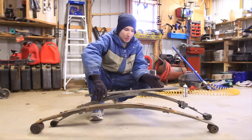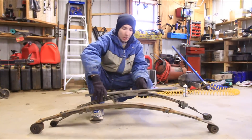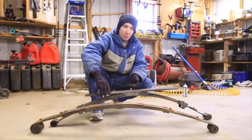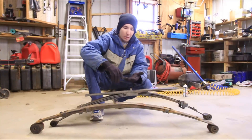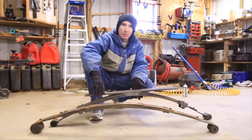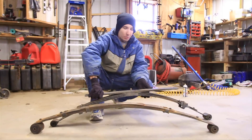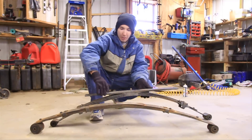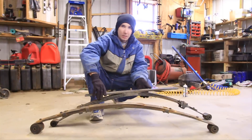There are two different ways you can do this — well, there are a lot of ways — but I'll show you how to get a two-inch lift all the way up to a three-inch lift on the springs. You can also combine that with blocks or longer shackles to make any kind of lift that you want. We're going to start off with the three-inch lift for my black Jeep, and I'll probably end up with about three-and-a-half inches after the shackles. Let's get started.